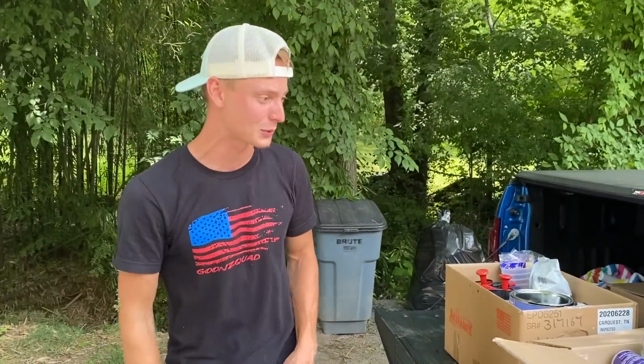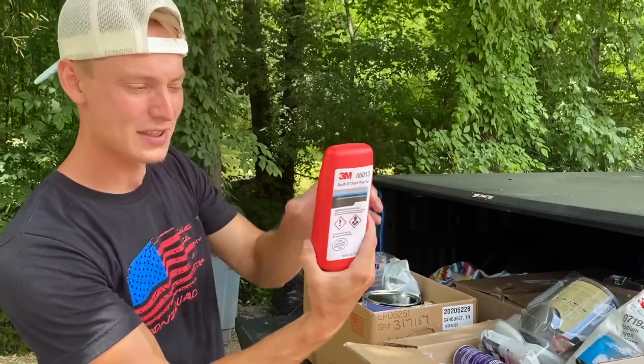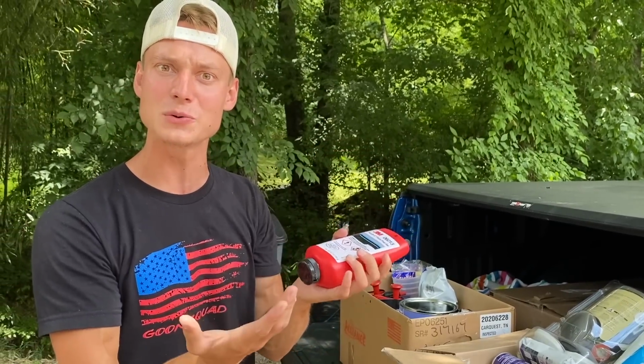And before we actually started wet sanding, we ran to the paint supply store to grab the scuff it stuff right here, which there it is. It's basically like the Gojo that you clean your hands with, and it just feels sandy. So that's pretty cool how it works on those rough surfaces, it just flies by.